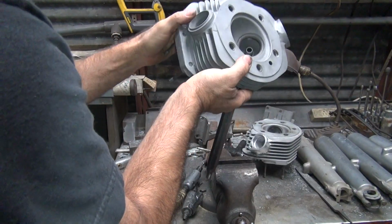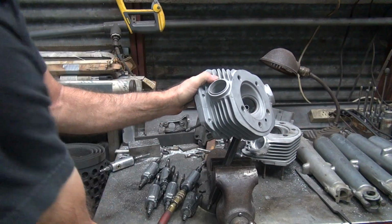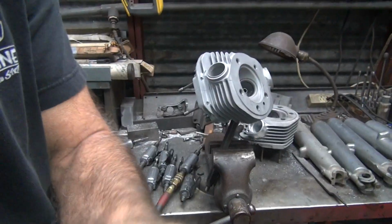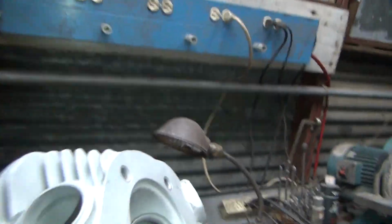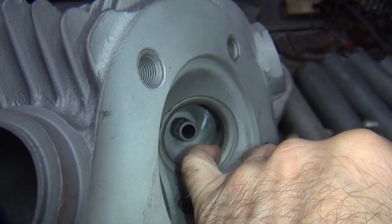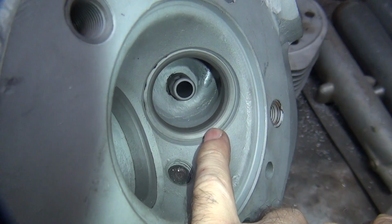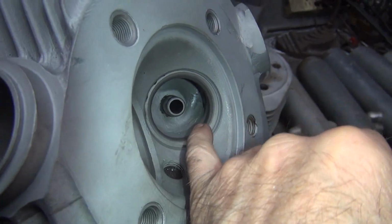And then I go over here. This side. And you can work on it from the other view. So you can see the exhaust port. It's got a chunky ledge right there. Not radiused. And you've got the rough port at the bowl down where my finger is. And you can see where I cut in with the other cutter on the other side.